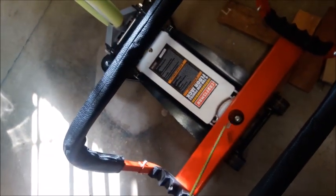One tip I learned from a body guy: get a reference point measurement of where the door is fully open. For a reference point, I'm using the center of the little star wheel there and measuring to the floor. Looks like we're right at 70 centimeters. When I get the new hinge on, I'll use the jack with the door holder and bump that up to 70 centimeters from that reference point, then torque all the bolts down to the hinge.